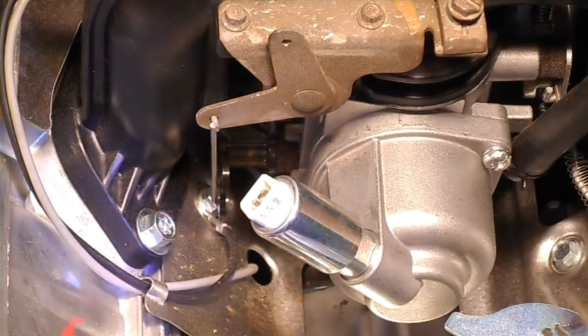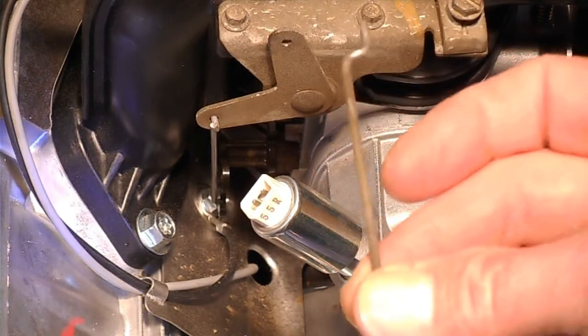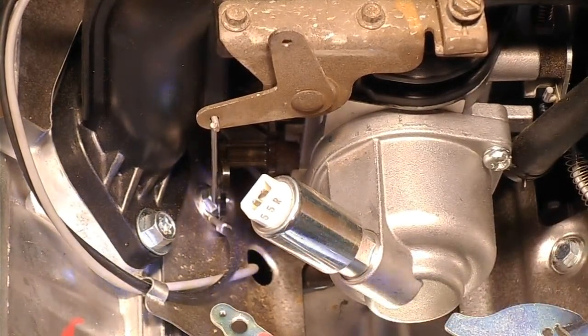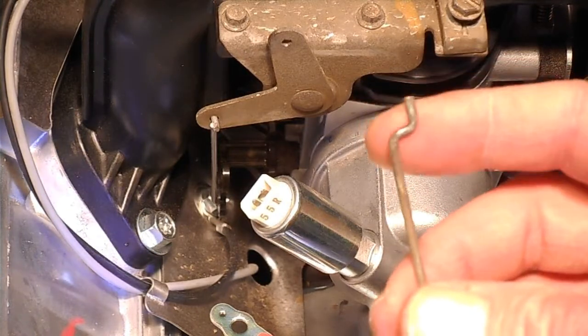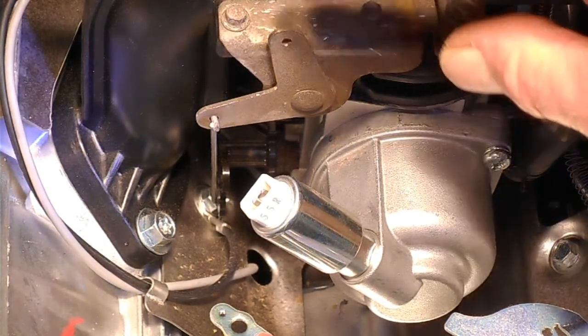This piece was larger than the holes that were actually cut in that piece of plastic back there. I looked at taking the carburetor off to drill it out, but that was just too much work. So I took a control linkage that was very similar to this but longer, put it in the vise with some pliers, and was able to re-bend it to recreate that hook right there that you need to get it properly in place. After about 30 minutes of messing with it, I hit success.